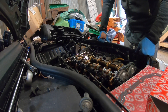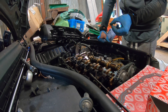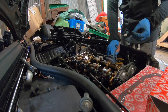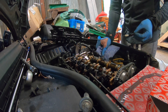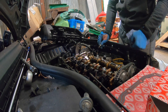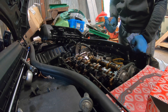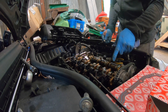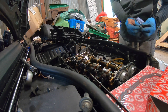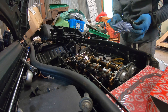Back on the Mini Cooper - just pulling the spark plugs out to do a double triple check of the timing. Interesting - I don't service cars much, it's not my job, but two of these spark plugs didn't even feel tight. The first two, second two felt better but yeah, not great. Pretty shocking.